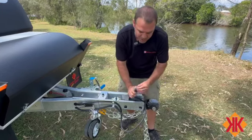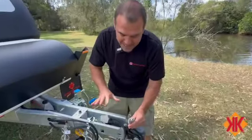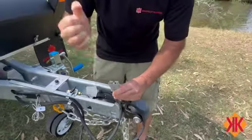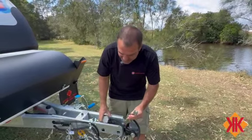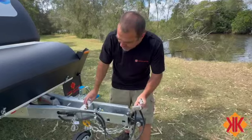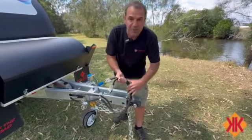The Anderson plug is for charging - a 50 amp Anderson plug that should always be plugged in. During a pre-inspection, make sure those silver tabs are pushed in. If you're not getting any charge, check those tabs and the tabs on the vehicle side. Always check my lights and signals before hitting the road. When I put my foot on the brake, I should hear that noise - it confirms I have brakes working on my tow vehicle.